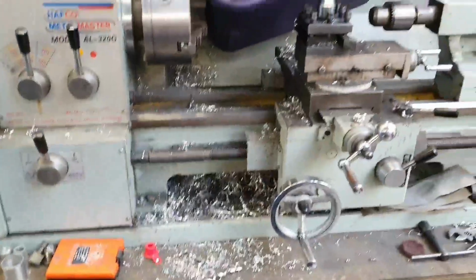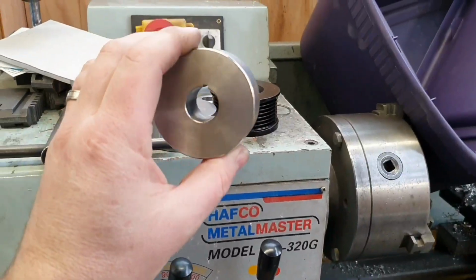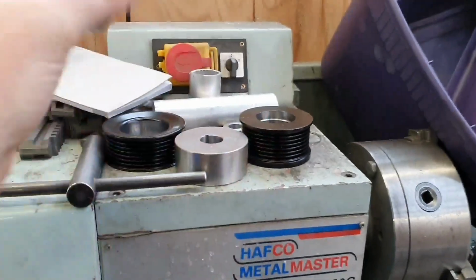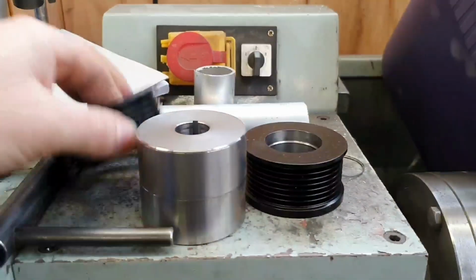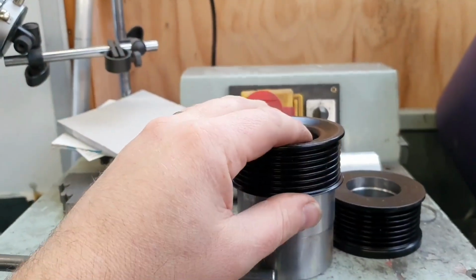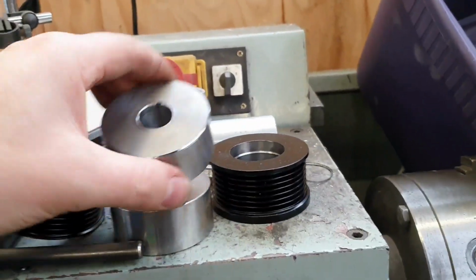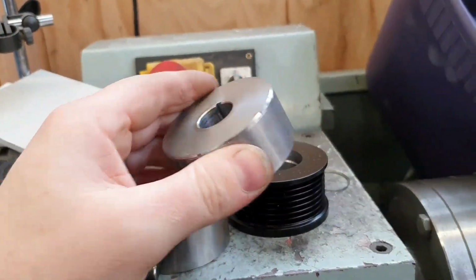Oh my gosh, I'm going to have to clean the mess here. But Kimberley Tool and Design in Waihi, they've provided us with the centres for our pulleys. So I'm going to machine out that. That gets pressed onto there, a couple of TIG welds, that's it, there's a pulley. I should have actually got them to do 3.